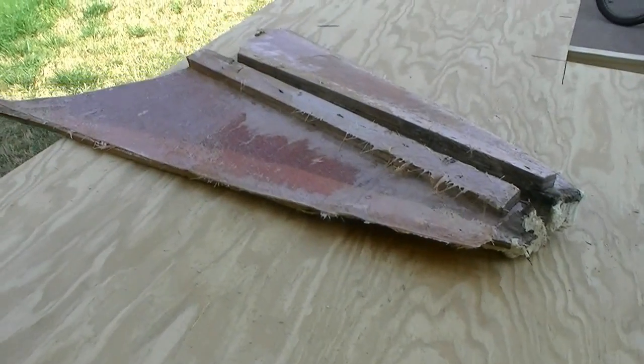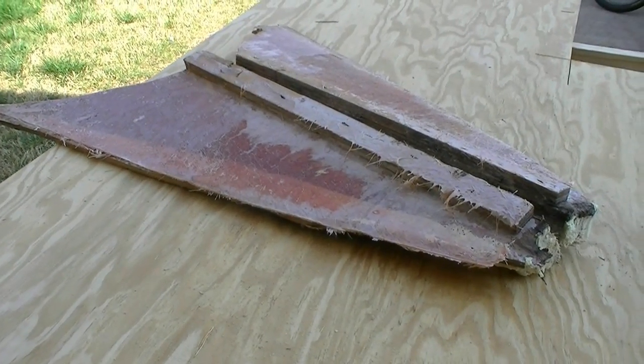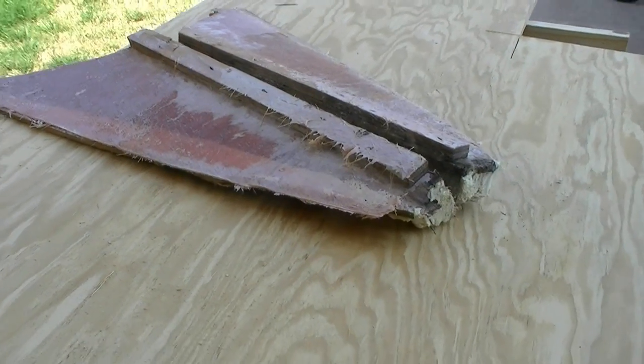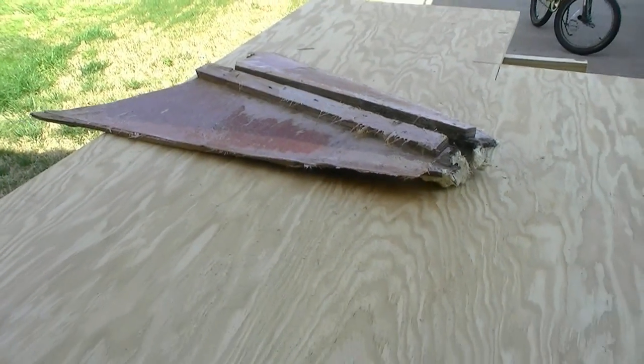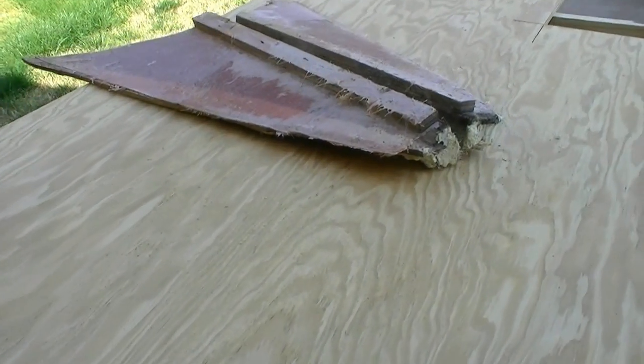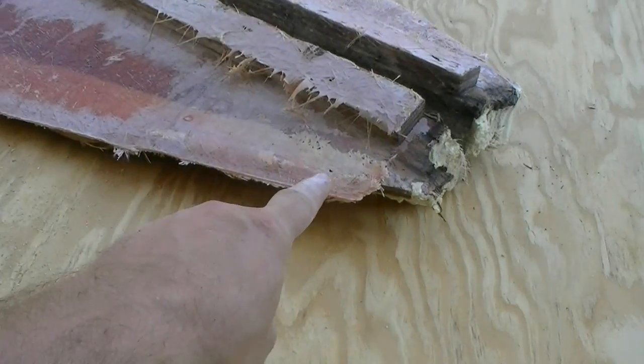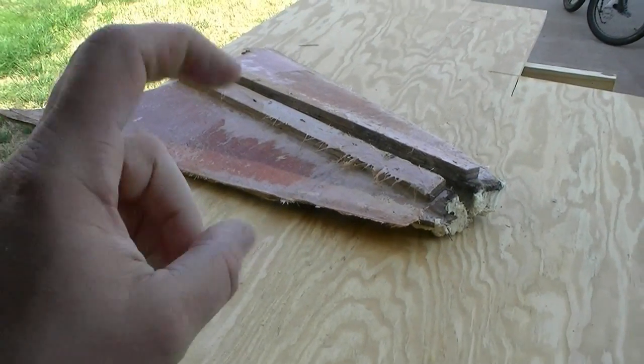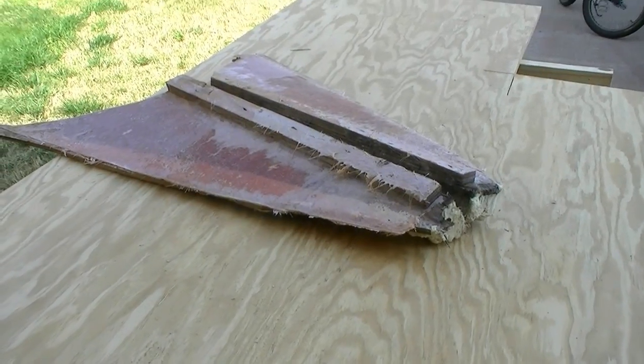What do we have here? That is the last bit of the stringers out of the front of the boat. I bit the bullet and cut them out because I'm going to use them as templates. It's much easier than trying to scarf it in. What I did is I took my angle grinder and cut the fiberglass and then just bent it over and it just broke off — their peanut butter that they had in there in the boat.